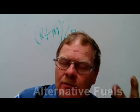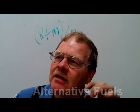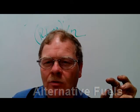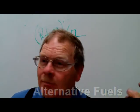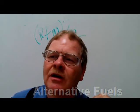Every one of those, and one of the reasons that some of our textbooks will say it's a good idea to buy a flex fuel vehicle, even if you don't intend to use the flexible fuel stuff in it, is because the fuel system is more robust. It's got a better fuel pump, better fuel injectors, better everything, because it has to have, because the alcohol is so corrosive and all that. You see?